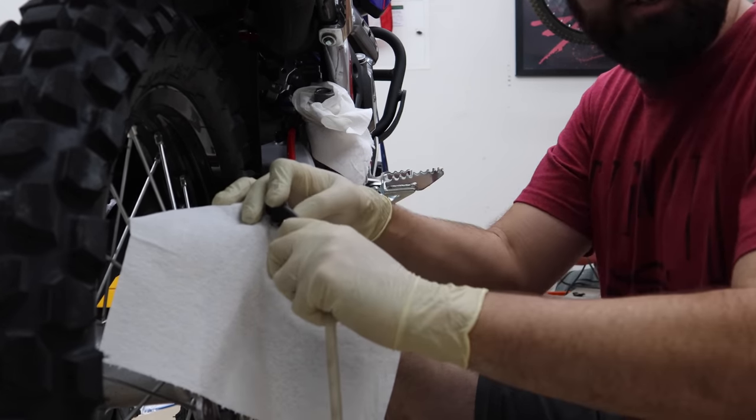Both ends have the exact same bend, so I'm just going to pick an end and go — we'll start down here. I'm going to fish this brake line around the backside of the fork, as that's how you should run it if you can. Snug this down by hand, leaving it still kind of loose. Get your CoreMoto logo the right way, fish it through these two guides along the forks, and then the brake line comes around and hooks right here into our master. If I were to leave it twisted and force it in, it could give it a little bit of a bend — just a little bit — which will end up making the brake line dance. By giving it a little forward throw, we end up with the line much further out of the way.